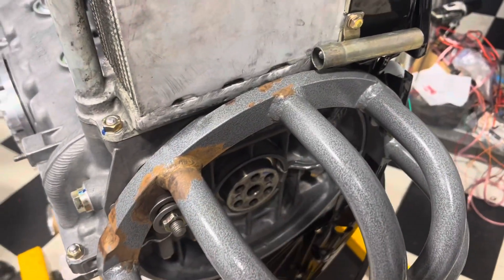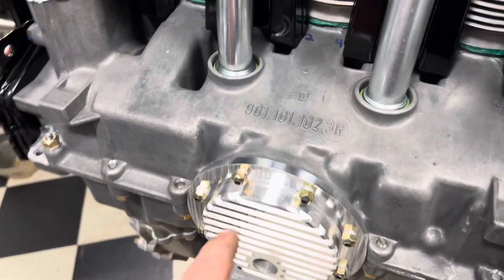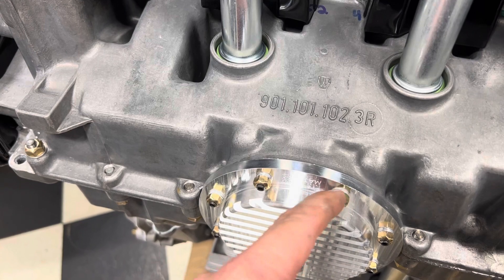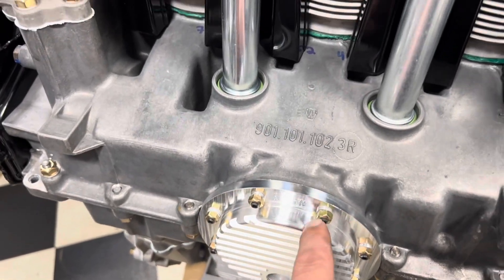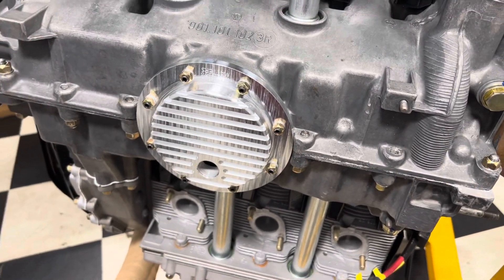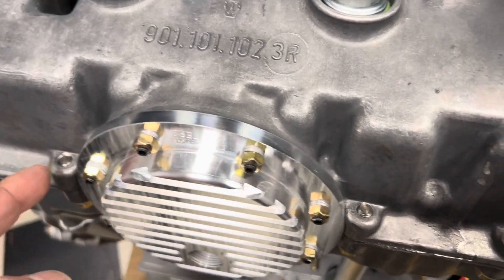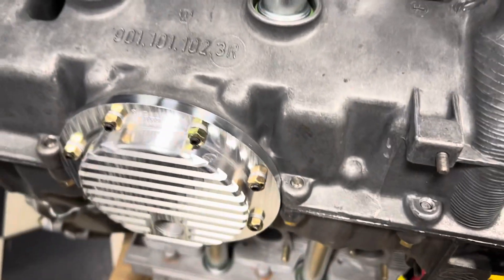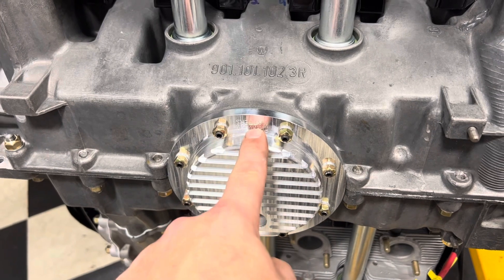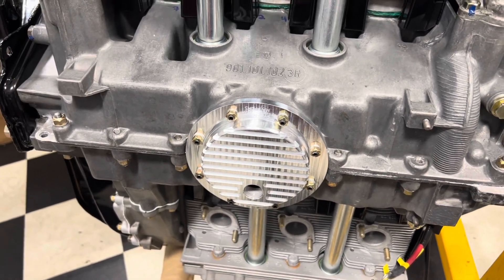We're going to put in the rear main seal because we're about to wrap this little lady up. We got our sump plate installed. Instead of using even the washers they sent us, we used the crush washers — sort of crush washers — that you use on the chain boxes, and also the all-metal lock nuts. If anybody from Precision Matters is listening: can you reduce the OD of this thing just a hair? It just needs to be a little smaller — that would be the only gripe I had with it. I did bead blast the inside surface, just to make sure shiny stuff doesn't always seal very well, giving it a nice matte finish.